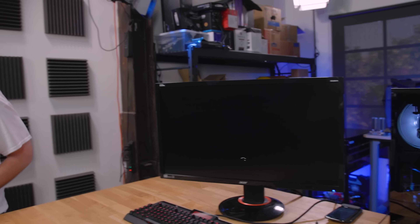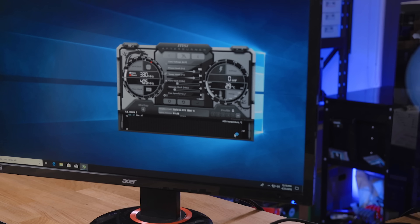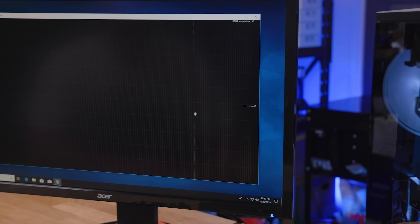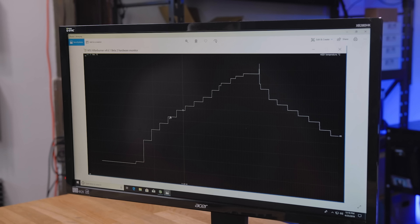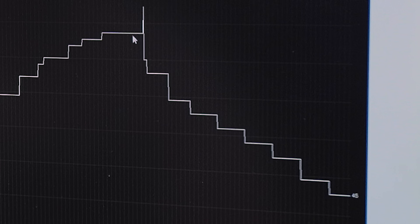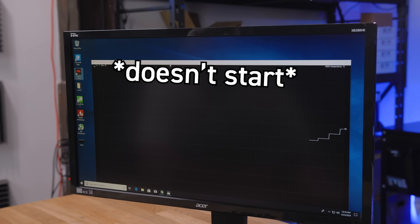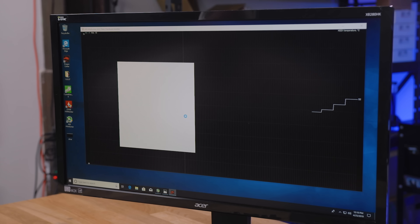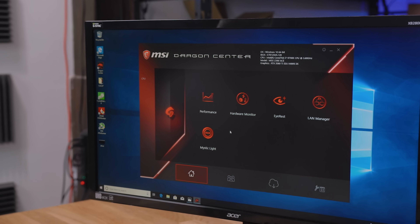The drive is sitting at 47 degrees with the fan blowing at it. I turn off the fan and watch — it's already at 48, the whole system is getting crazy, already at 52, and we're going to start slowing down. I need to open Dragon Center. Oh no, now it's a white square — Microsoft Windows is not responding. I need to turn the fan back on. You see how we turned the fan on and it started coming back? It's completely temperature-dependent.